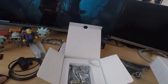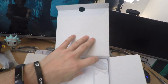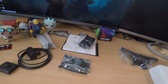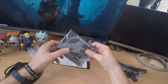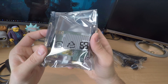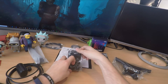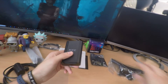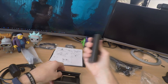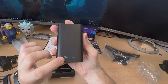Here is the PCIe card. It needs to be installed in a PCIe X1 slot, and if you can't do that you need an X4. I did find that was a problem because the X1 on mine would not allow me to install it — there are two screws on top of the card which scraped along the heat shield protecting my IO outputs on the back of the motherboard, making it basically impossible to install in the X1. It may vary from motherboard to motherboard, but I'm happy to report that it does work in the X4, so it's fine.